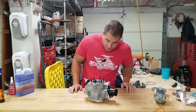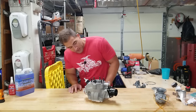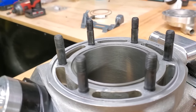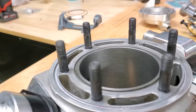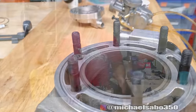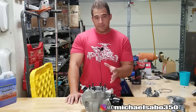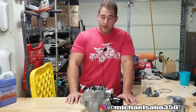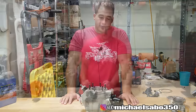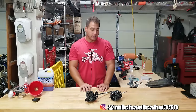You want that 45-degree angle on the cross hatching because you want the oil to flow — if the angle isn't steep enough, the oil just sits on the shelf and doesn't recycle. Success — I think the cylinder is perfect. We're going to check the ring gap to make sure we have adequate space. If you decide to do this yourself, just remember to take your time. This was my first time using a ball hone and I think it came out absolutely excellent.